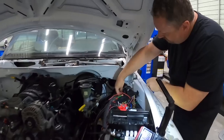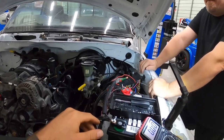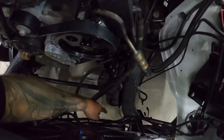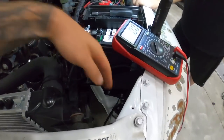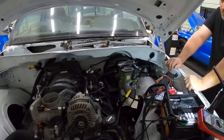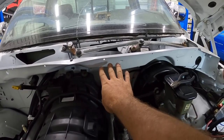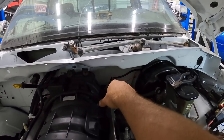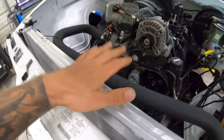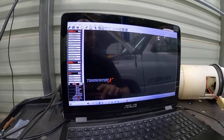Little update: Dennis is working on the alternator wiring — we had to order some parts for it. We got the fans working though. This wire goes across the radiator, into a relay, and runs all the way to the back. We wired into the Holley input/output jumper. The Holley gives you four outputs you can control, so both electric fans are going to be controlled by the Holley ECU. Let me show you where that control is in the software.